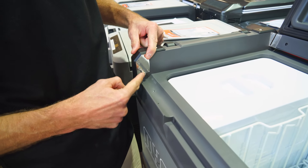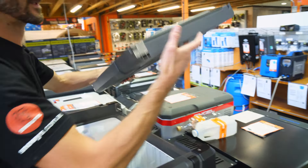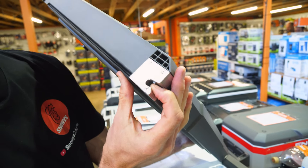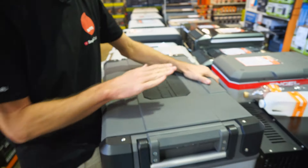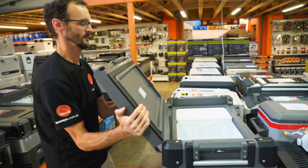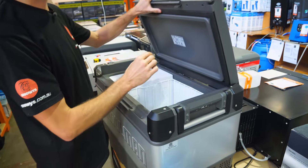There's another hinge on the front that allows us to reverse the lid. To pop it off, push it backwards and it pops out of place — there's a spring-loaded hinge in there that holds it. We can now flip it around, put it back down on this side, line it up, give it a tap so it locks in, and the lid is reversed. An easy way to change the lid direction and reverse the hinge.